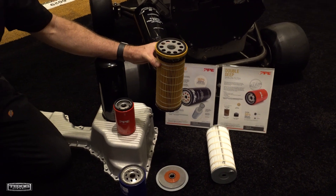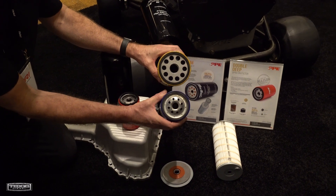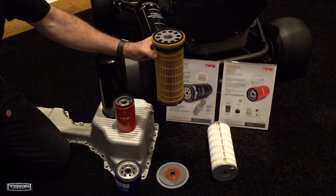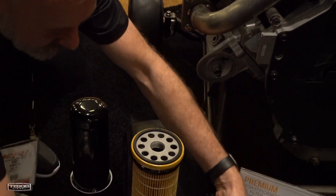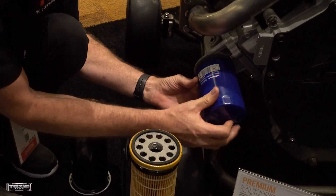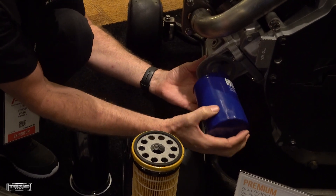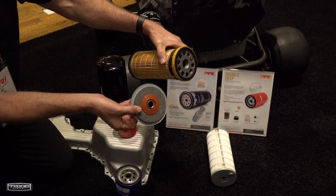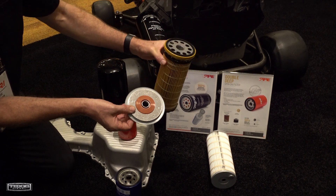One of the biggest ones we saw was that not only does it not fit directly — which is kind of a pain — but the second thing is that the application which the CAT filter was designed to work in is engines and heavy equipment that has a backflow check valve incorporated into the engine system itself. The Duramax engine was developed with the filter to have the check flow valve in the filter itself. So when you apply the CAT filter in this application, you are allowing oil to drain back from your motor into the lower cavities of your oil system, and that's going to drain your oil galleys, your camshaft, your rod bearings.